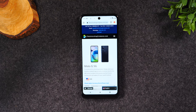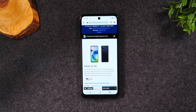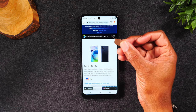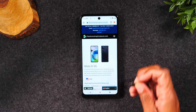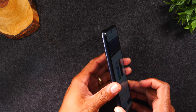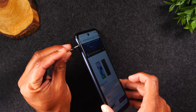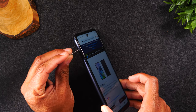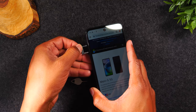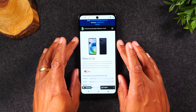Once you get that final email, you do want to have your SIM card ready to go that you want to use for the phone. Also find the box of your phone and grab your SIM tool out of the box — it looks like this. If you happen to have thrown your box away, no problem — find a paper clip and simply bend it back. Then you'll need to find the slot on the phone where your SIM card is. For this phone it's on the left side, this little hole right above the SIM tray. I'm going to use the SIM tool, put it in the hole, push, and it's going to pop out your SIM tray, and you're going to put in the new SIM card of the new service you'd like to use with the phone.